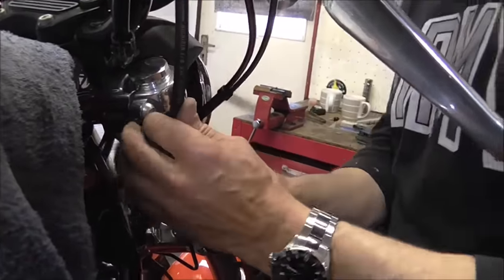Your Harley dealer will sell brake pipes for you. Your indicators — they sit on a little swinging ball joint, so just face them forward unless you're going to relocate them elsewhere. It's important to take a swing over the bike, get a feel for where everything is, make sure everything's sitting neatly, that you can reach everything, the levers are all comfortable. Final thing is to turn it lock to lock and make sure everything's moving and nothing's chafing.